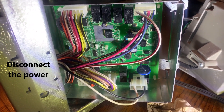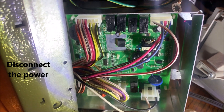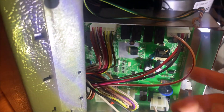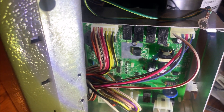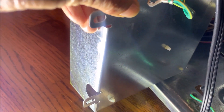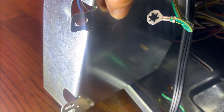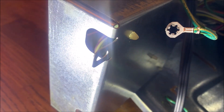To remove the control board from the housing, I disconnect all the cables first. There are cables in the front and then there are some plastic clips on the back that you want to push, and then push it out so the board will be detached from the housing.